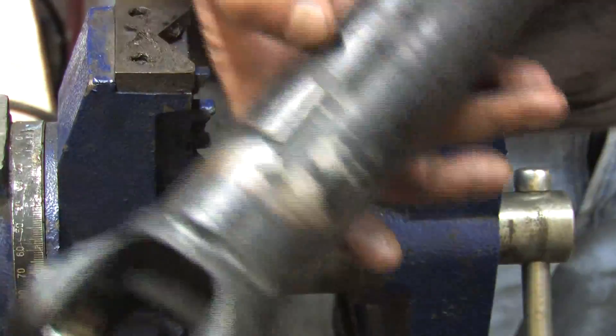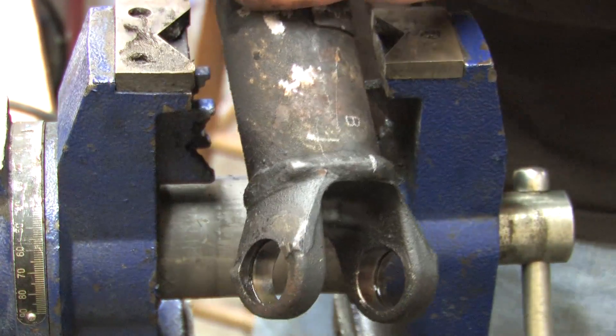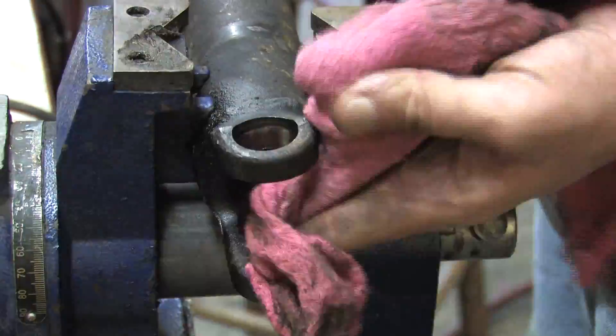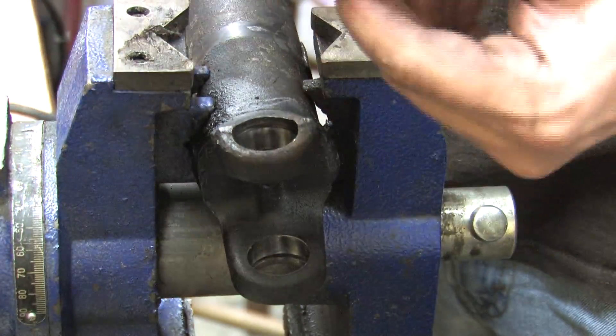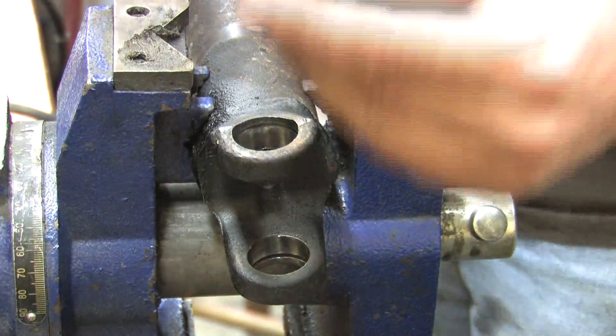We're starting with the front shaft. Because we'll be pressing an assembled yoke onto the A joint, we're going to start on the B joint first. Clean all the gunk out of the bores using your favorite solvent and a rag — I'm using carb cleaner. It's a good idea to grease the bores, but you'll see we didn't do that here. You'll also want to add an extra dab of grease to the end caps; excess will press out, and there's no need to fill the caps entirely.